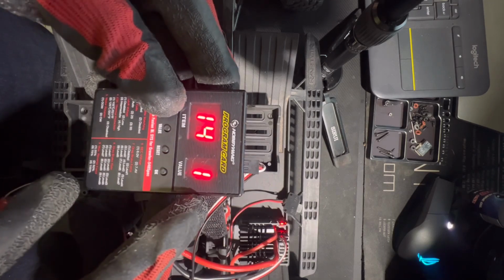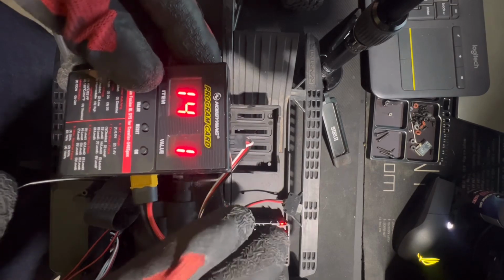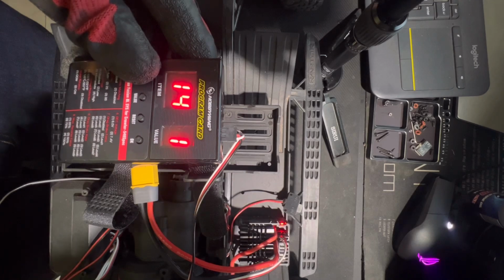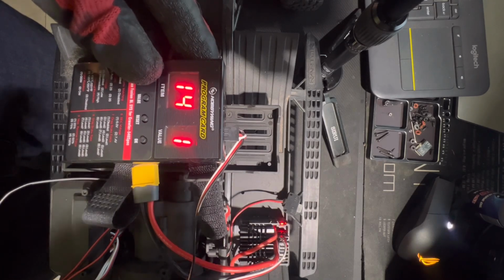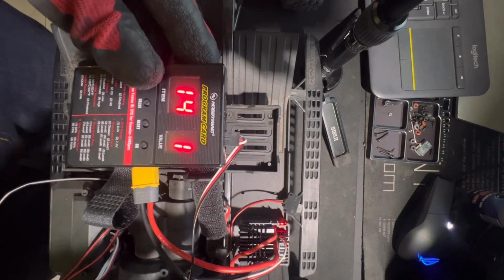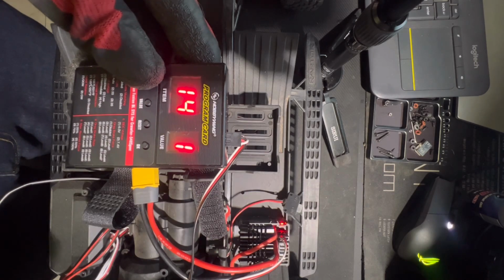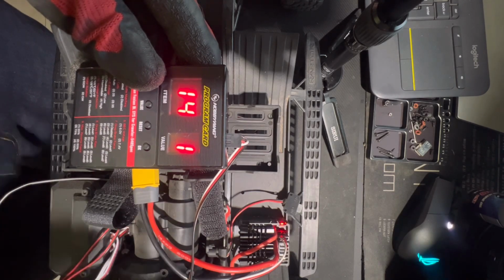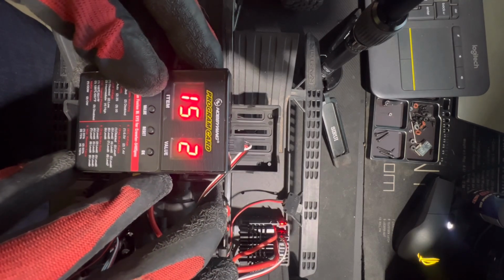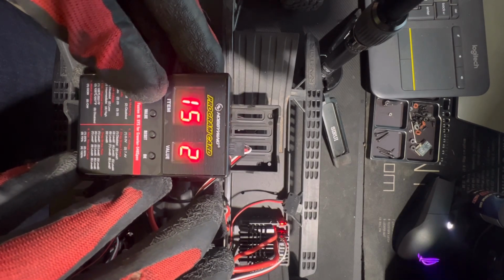This will be very important because I assume all these servos in here, especially the small ones, there's a chance that they might be a max of 6 volts, and putting them on 7.4 might just blow some of them off, so we don't want to do that. We don't want to be replacing servos. That's an expensive mission. So if we put another system in here, this is the benchmark. We're going to keep it on 6 volts. And the last option, option 15, is freewheeling, and that's currently disabled.